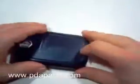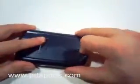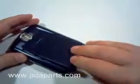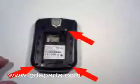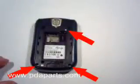Turn the unit over and remove the battery cover, and then remove the battery. With the battery cover removed, you will find 3 Torx screws that will need to be removed with the Torx driver.